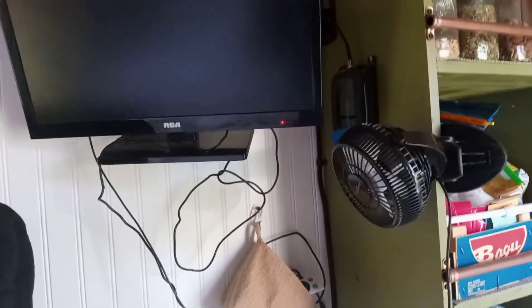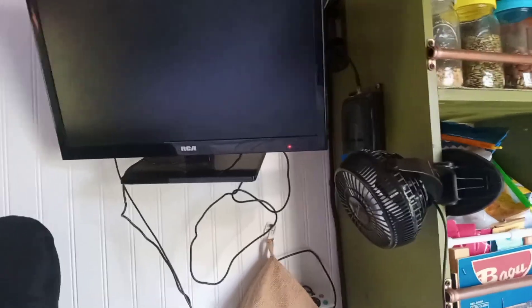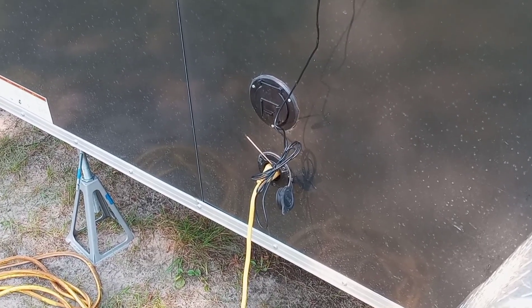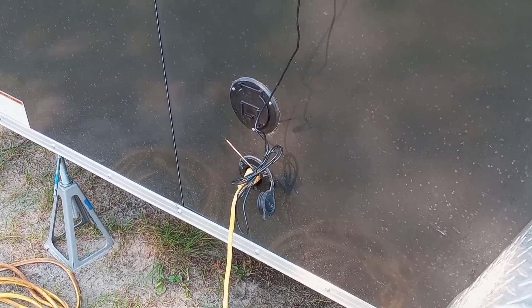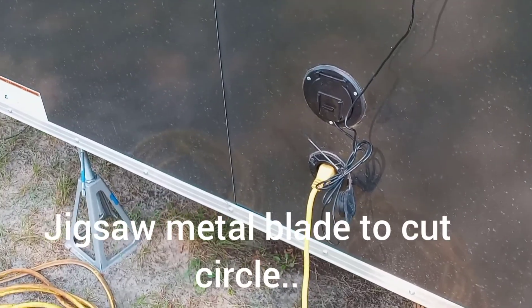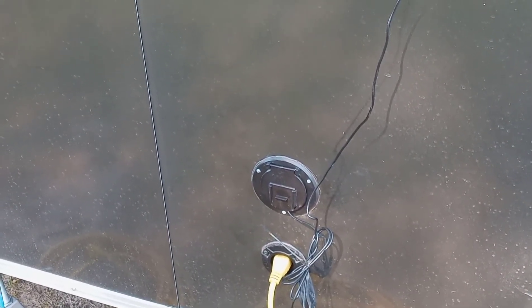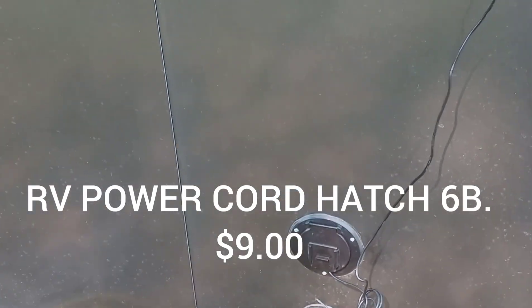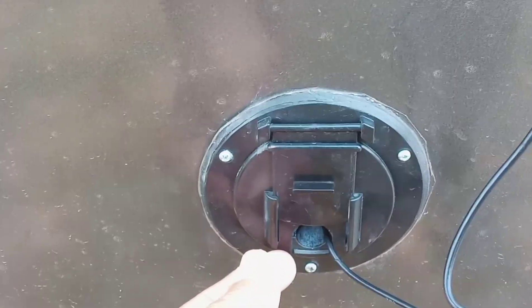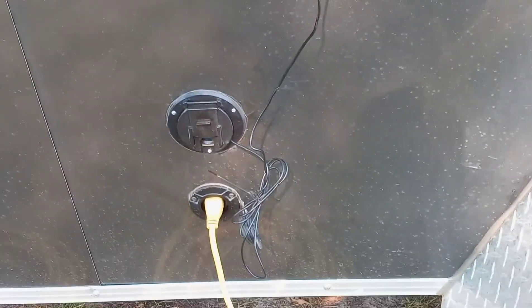We'll cover 12 volt at a later time and how we handle that. Getting on the install is super easy — I believe it's like a 2-inch diameter hole for the plug portion. Just pass that through, three self-tapping screws and some caulk, and you're all set. I believe that hatch above that was like a 4-inch hatch. If you just search, I think, a marine hatch, it'll come up. It gives you an option to pass through a small cable, or pop it open and pass through something big. That's worked great for us.